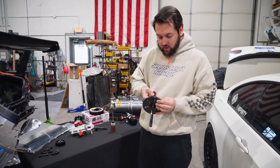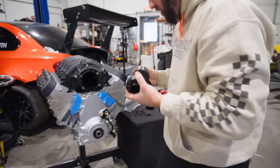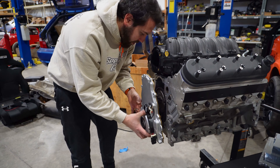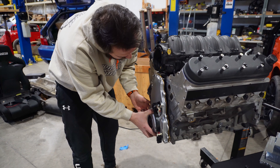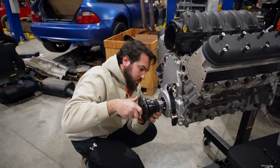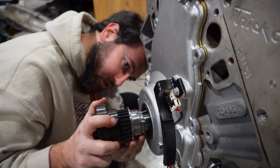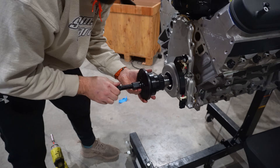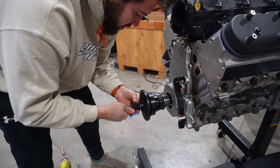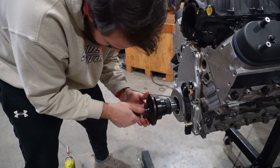Okay, Kyle assured me I was using it right. So this one has a key — I'm going to put the key in the hole first. Normally this is the hole where your stock oil pump assembly would send the oil. It's a little bit longer but it looks normal once you get to here. This is how it centers it, and then this part threads into the crank itself. Once it's in there with the rotations, we can put this part flush with here.